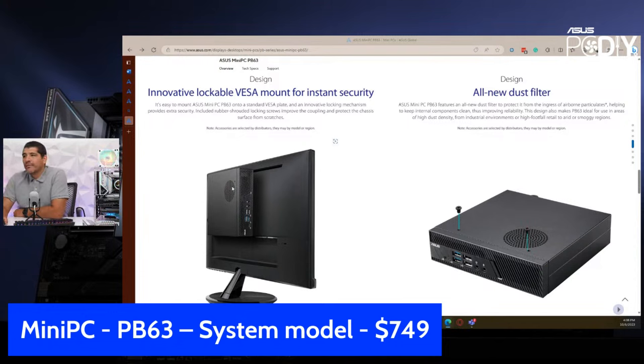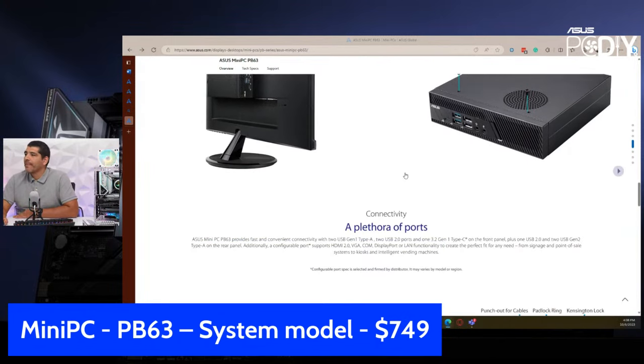We also have new mini PCs in the PN series that actually have what's called the dust channel as part of the fan design, where essentially as dust, debris and dander comes in, there's a secondary channel on the inside of the fan housing where that particulate settles into that other space and gets exhausted back out of the chassis. That helps to reduce the likelihood of the internal heatsink getting clogged up with subtle dust, debris and dander over time, okay?